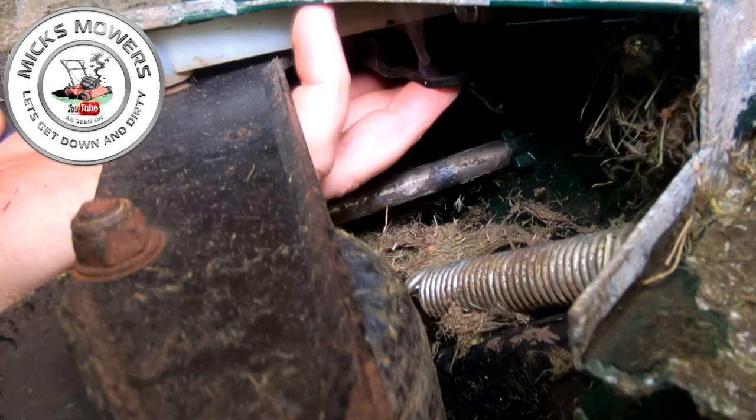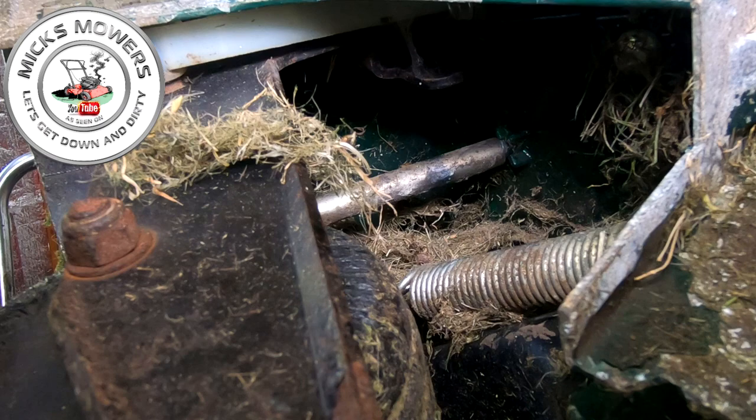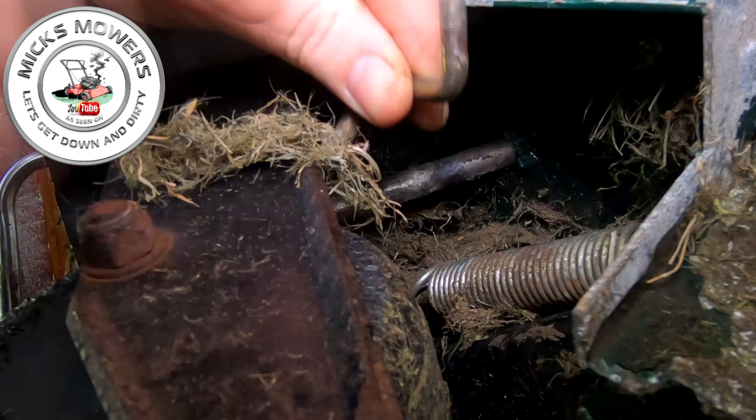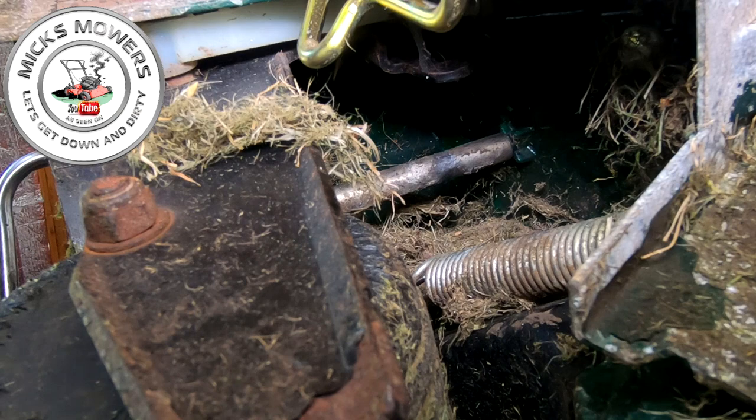I think we're there. Yeah, there you go. So there's a rod, now been removed. Cool, and that's the bit that sits up inside here, okay, and there's a little tiny eyelet for it to sit just up here where my finger is. That sits up inside and the circlip sits on top like that. So with the new bar, I'll show you what I mean. It sits up like so, okay, and then the spring attaches to this end of it, okay.